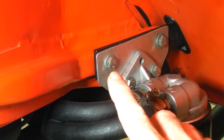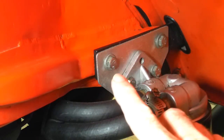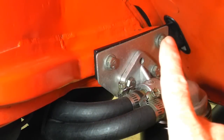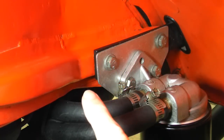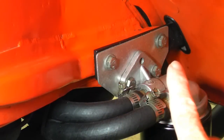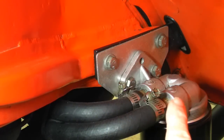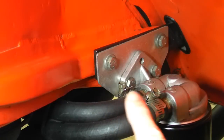What we did is we utilized the two mounting bolts for the bumper bracket right here, and followed the contours of the line of the bracket down here. Made a little taper on both the forward and rear edges, and then we mounted the spin-on filter bracket to that piece right there.